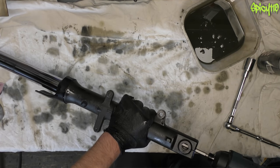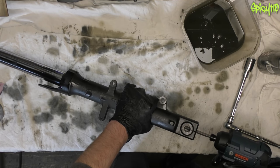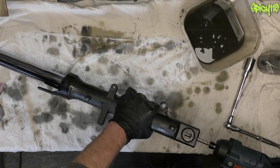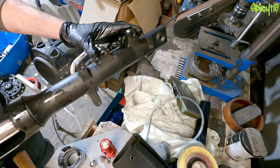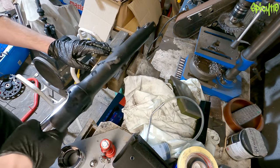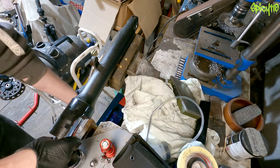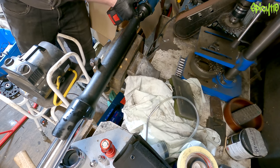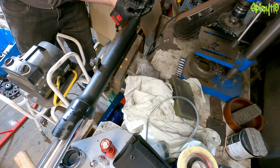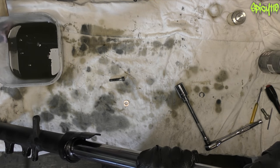That's really in there. I've got some pieces of wood in a vice and I'm going to use the two caliper brackets in line to clamp that down. Going backwards and forwards a couple of times — got it! Top cap back off, tube out.